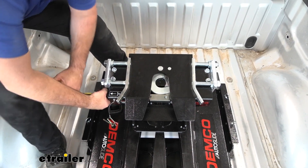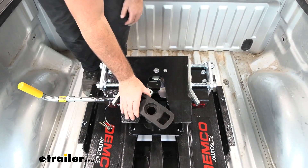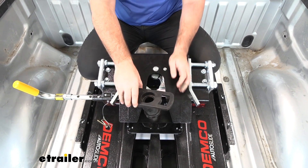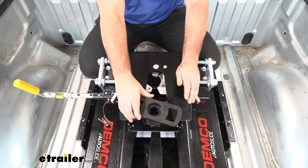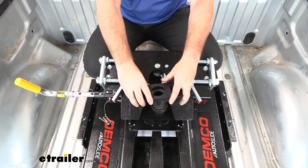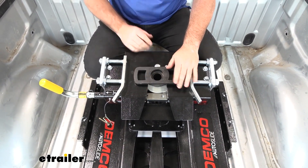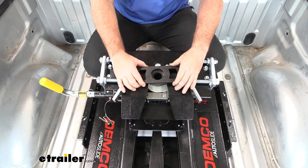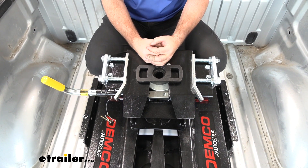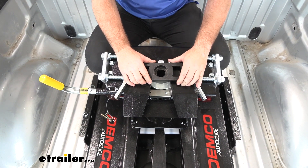We're going to have 360 degrees of contact. We slide that open. A nice feature is — even if this is a little worn and loose — it's going to be auto-locking. When you couple up your trailer, you don't have to come back out and lock it into place; it's automatically going to do it. Even with this worn out, there's not a whole lot of play, so we're going to have a nice tight fit around that kingpin. We don't have to worry about a lot of movement there that we may feel in the vehicle when we're pulling a trailer.